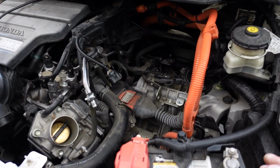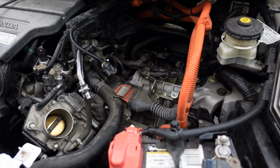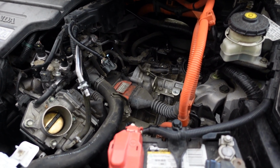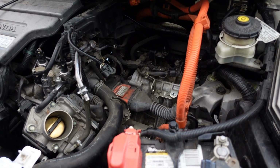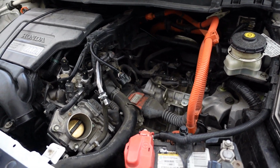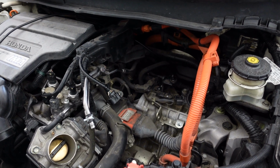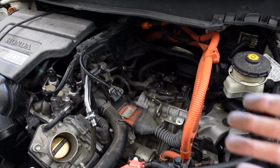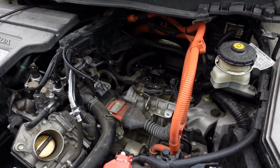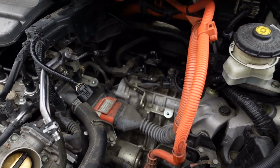That would also explain the instantaneous failure that I had when I was going to work that day, because everything was perfect, and then all of a sudden, pop, everything went to shit, and it's been crap since. The cage failures on bearings are extremely difficult to predict, and they can give warning if you know what you're looking for if you're doing vibration analysis, but obviously I wasn't on this because most people don't do serious, you know, Fourier transform type vibration analysis on their auto transmissions. So I think that's what we got.